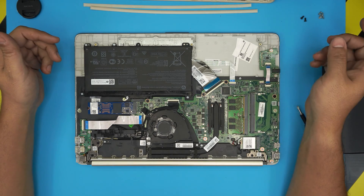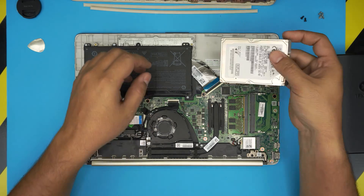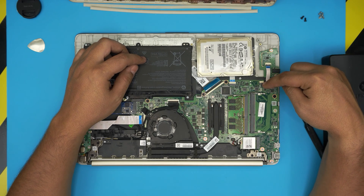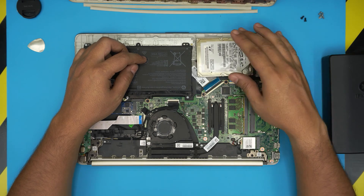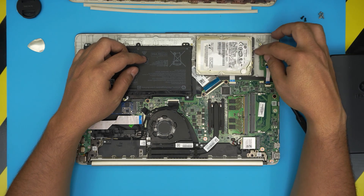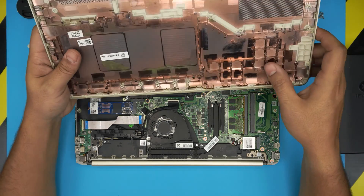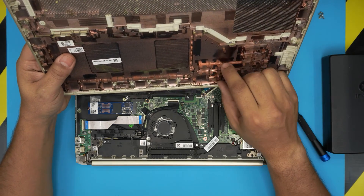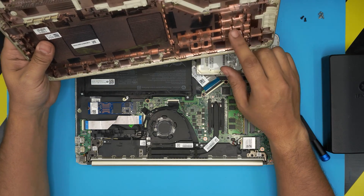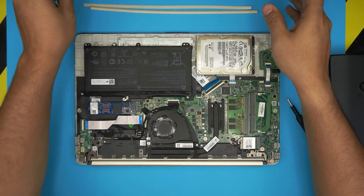Once inside the laptop, you'll notice there is space for a mechanical hard drive — it would sit right here with an adapter connected to this connector. You can connect a mechanical hard drive, but there is one big issue: it has to be a low-profile mechanical drive. There's also no caddy available, so you'd need to purchase a SATA adapter for this connector. You'd also have to remove all these fillings here that fill up the empty gap, which is a lot of hassle. If you don't want to do that, don't worry about it.